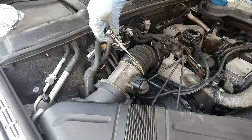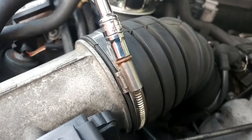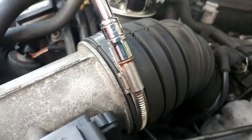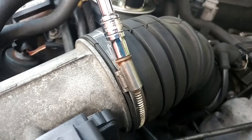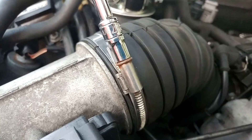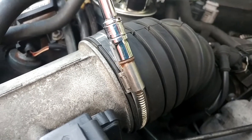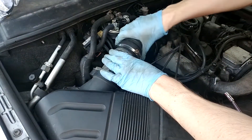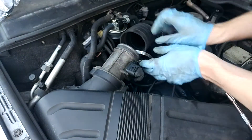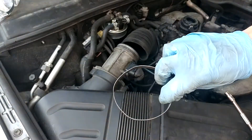It was the Jubilee clip not fully tightening — I'm going to show this on screen slipping in a moment. I'm really surprised at this because when I've been in Vagcom and logging things, I've been seeing the full one and a half bar of boost that I should be making from the turbo, but it's been a bit delayed. It is a high performance turbo capable of over two bar, so I think it's been working harder to make the boost. You can see here it's not just clamping down on the Jubilee clip, or the worm drive clamp as you may know it. I've got a new one to replace it, and as we take the old one off it doesn't look great — it's not quite the right shape, it's certainly not wide enough, and as you can see it was slipping.